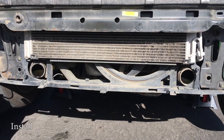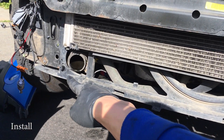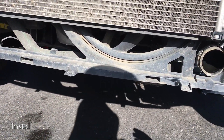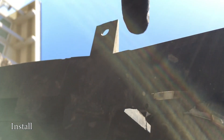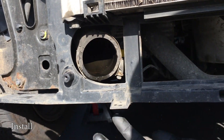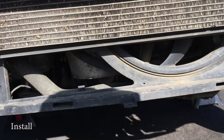The intercooler was held on by four bolts — there were two T25 ones, there's one right there and the one over there that held the mounting clips in place. Underneath there's a spring clamp, and you can access it through this hole right here. Just use a flathead screwdriver to unscrew that — the other one is right here, same thing, just get a flathead screwdriver and unscrew that. But once those are loose, you can just pull the whole thing out.